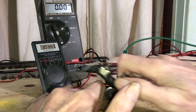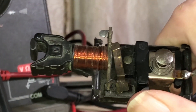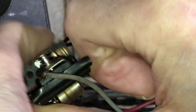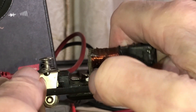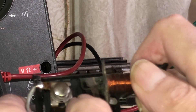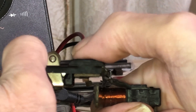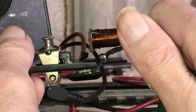Here's one I have partially disassembled — this one's no good, the coil's gone in this one. This tab is the end of our coil. The last wrap of coil comes up here, gets bent 90 degrees straight down, then 90 degrees to the left. That contact spans the space from here to the sliding shoe. When you activate the sliding shoe — it rides up on those activation rails — it'll push up on that and make contact to hopefully fire off your coupler.